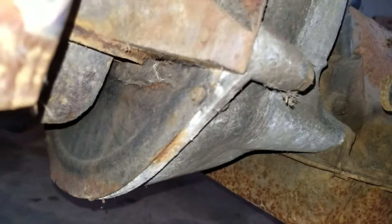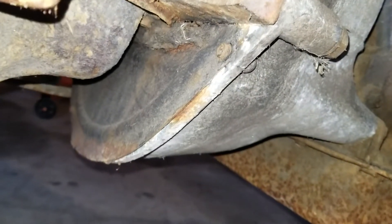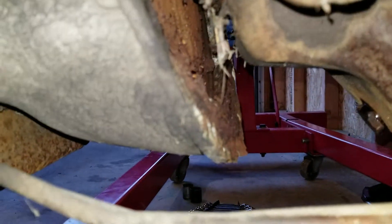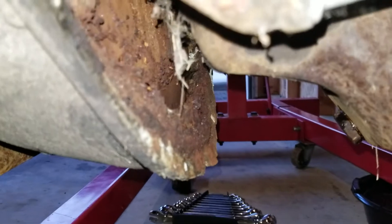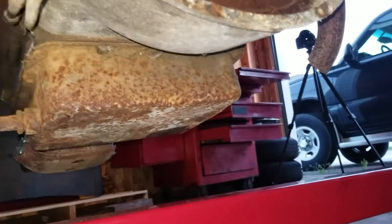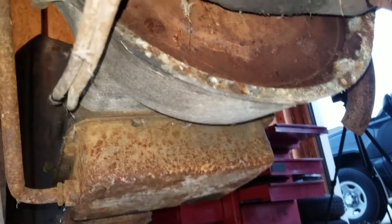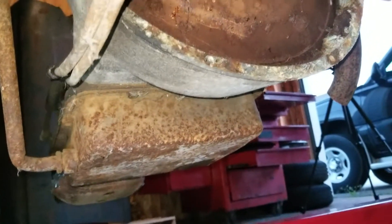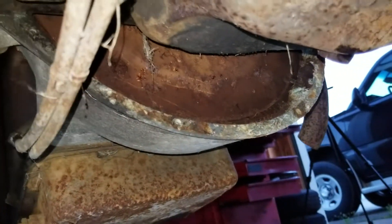First thing to get this motor off is removing that cover right there. I think it's just four bolts and four screws. Then we will rotate the motor and take each one of the flywheel bolts off of the torque converter. The bolts are little hex heads — on my other motor in the Rambler they're 5/16ths. We'll get these out and see what lies behind. The cover is off. Behind it all is the torque converter, and behind there is actually the flywheel which is connected to the torque converter. Based off of that I'd say this trans needs some serious help, possibly even the motor. But we'll see when we try to start it up in the next video.